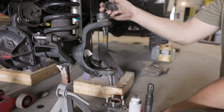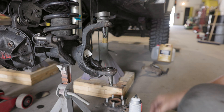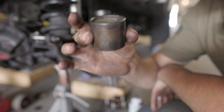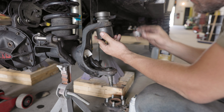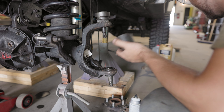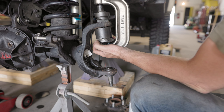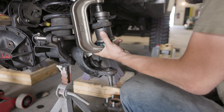Now for the top one — I've already got it in position and everything squared up. I'm just going to use a little cap that is in the ball joint press kit. Stick that on top and we're going to push straight down on the body of that ball joint. Typically on the bottom I have some adapters in these kits, but this one's not working for the upper — it's just slipping and rotating. When I use just a pipe piece, it's not square — it's kind of tilted. So I'm just going to put this little washer right in there after I'm set up. I don't recommend doing this — I just can't find the correct tool at this point and I need to get this job done. We're going to use that same bottom piece, just with a little cap on the top of the ball joint, fish everything up through here, get it all lined up, and put that washer over here just to square it all up.